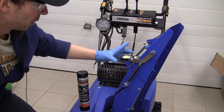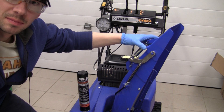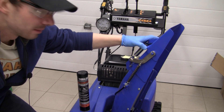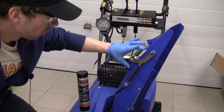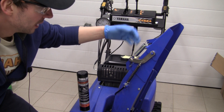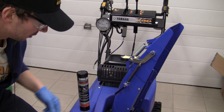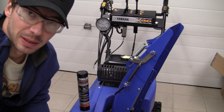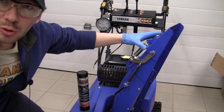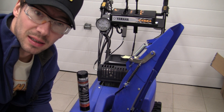While we're here, we're going to do a little bonus feature — remove these two pins, inspect them, clean them, grease them, and put them back. I'm going to start by getting these two cotter pins out. I'll leave the spring in because the spring might hold some of the chute together. I got the two cotter pins out; I think I'm going to have to hammer the pins out based on the fact that they don't seem too willing to move.